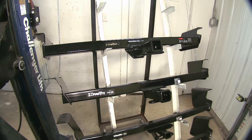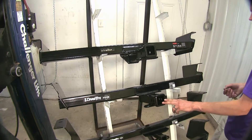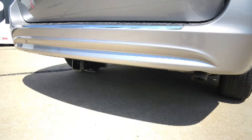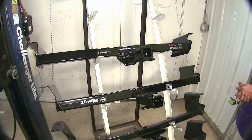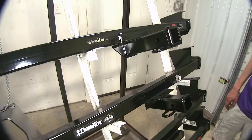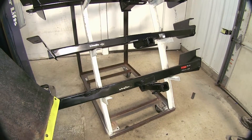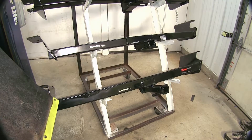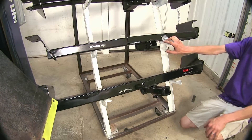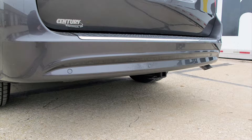As far as the two Class 3s go, I'm more inclined to go for the Draw-Tite just because it is a little bit more recessed and it does have the J-Pin stabilization hole, which makes it easier to eliminate the shake, play, and rattle in the receiver for accessories — you don't have to listen to it while going down the road. Another reason I like the Draw-Tite is because you don't have to use a stabilization strap. Now if you already have a lot of 1-1/4-inch accessories and would prefer a Class 2 hitch, I would still go for the Draw-Tite again because it's more recessed and you don't have to worry about the stabilization strap for a non-trailer application.